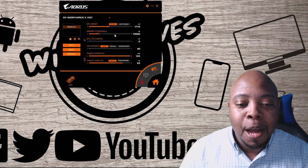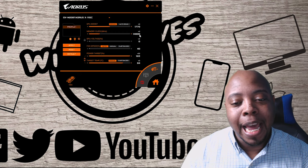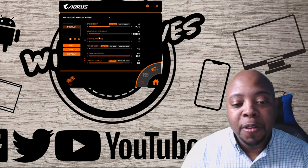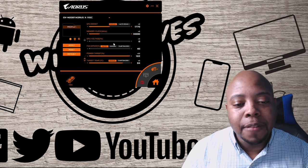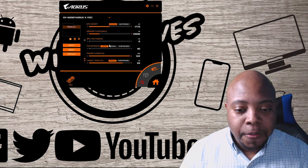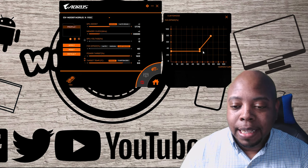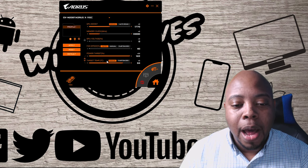Memory clock, man, you could pull this up above that. Normally when I'm overclocking, I normally add on like 1000. It always depends on the actual card, but I normally do 1000. GPU voltage, I haven't touched this, but you can actually mess around with the slider for the voltage. Fan speed, I leave this on auto, unless I'm doing something different. You can actually customize this. You could change it to manual. You could change it to customize, and you could set up your own fan curve, stuff like that. I normally leave that on auto.